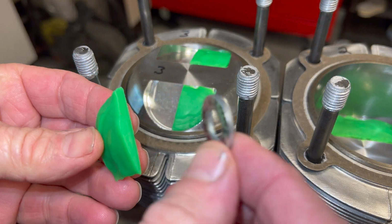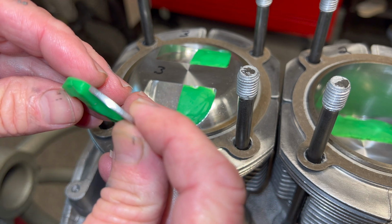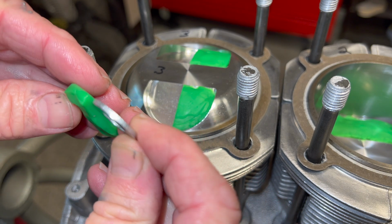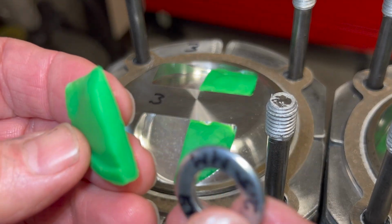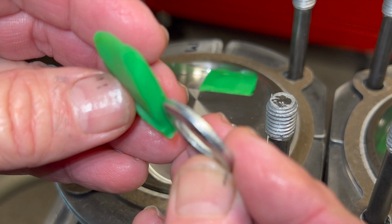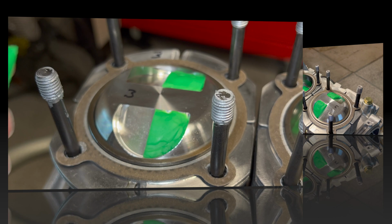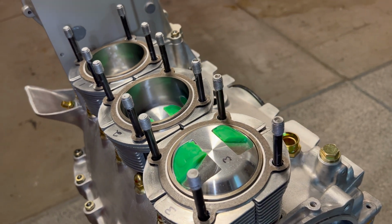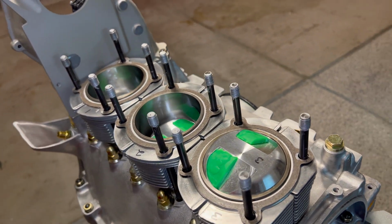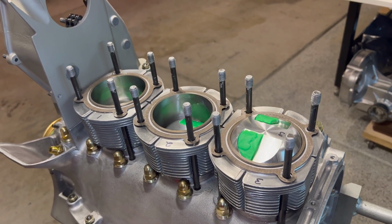Okay, so our intake valve, this is really what we need bare minimum to make things work. You can see we're well within that range there. And our exhaust valve, 2.5 millimeters, well within the range. Yeah, no problem at all. Okay, so we got through that one safely, and I got to tell you, what a brutal process to try and find a measurement on something. A whole lot of work here.